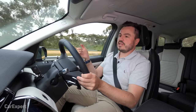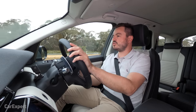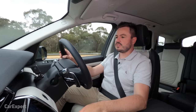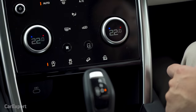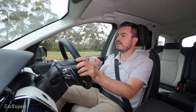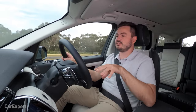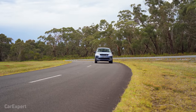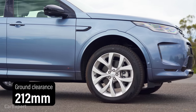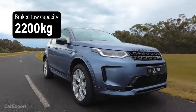You don't have any on-road drive modes as standard — you can get adaptive dynamics and adaptive damping as options. Hitting the terrain response button brings up a variety of modes for off-road driving. There's also hill descent control and a speed control for off-road where the car maintains a set speed and manages traction itself. This makes it a really good alternative to ute-based SUVs for light off-road driving. Ground clearance is 212mm, and towing capacity is just over 2,000 kilos braked.